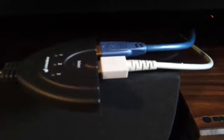This is the AverMedia Game Capture HD2. You can see I have a 32GB flash drive in there. You've got the headphone jack, the mic, HDMI, power, and all that. The way I have this hooked up is with an HDMI splitter. The blue cable is going from the Xbox into the splitter, and the white cable is coming from the Wii into the splitter. Then the splitter goes into the input on here, and I have HDMI going from the out of this into the TV.